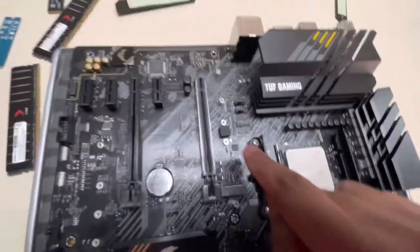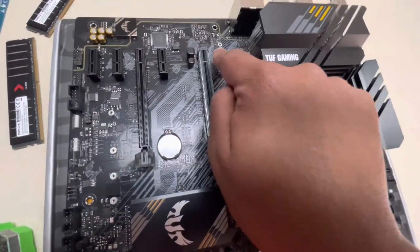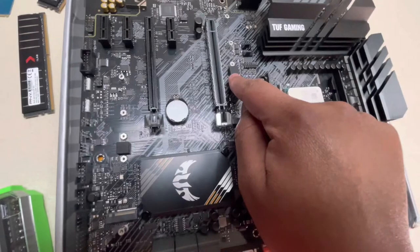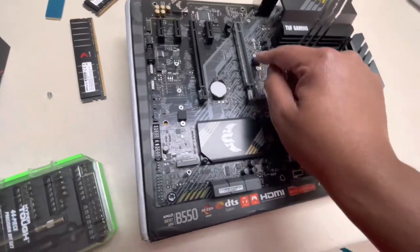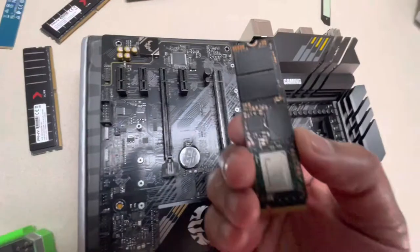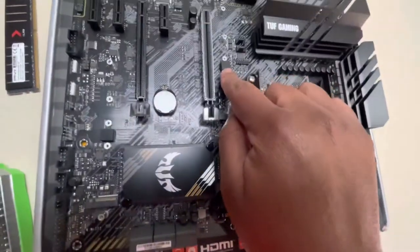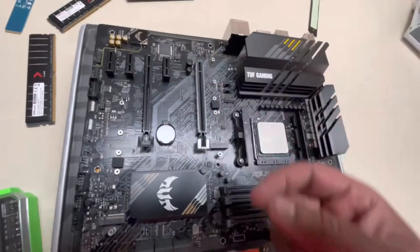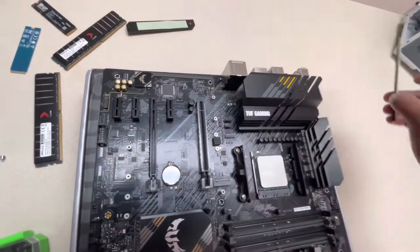So if you hook up the Gen 3 M.2, SATA slot 6 is not going to work. Over here you have your Gen 4 M.2 slot, powered by the CPU. The drive I have on here is a Crucial P5 1TB Gen 4, and it's also single-sided. If your M.2 card is double-sided — meaning it has chips on both sides — you don't need the extra thermal pad piece. But if it only has chips on one side, they include small square thermal pad pieces you peel the film off of and apply. The Gen 4 M.2 cover also comes with a thermal pad that has a clear protective film — remove that before installing.